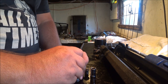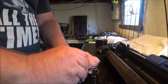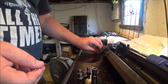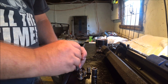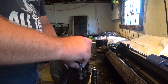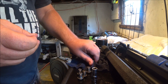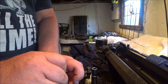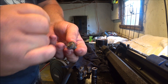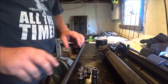I feel like I've got more than I need here. Yep, it's operating fine. That one's fine. That one's fine. That one's fine — let's pump it out. All good. One more. Oil coming out of that, which is what you'd expect; it's coming out through the little hole in the back, which is a relief. So I've got six there — I think I've put two engines' worth of squirters in the same box, so I've got a spare whole set.